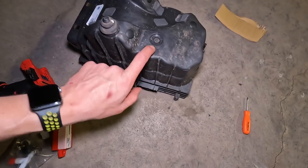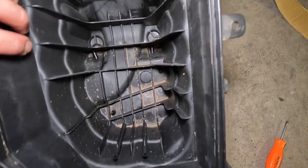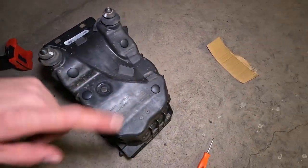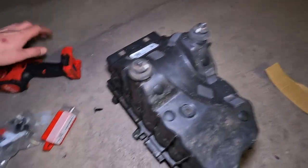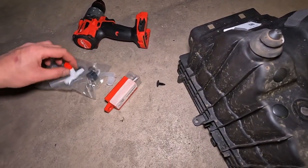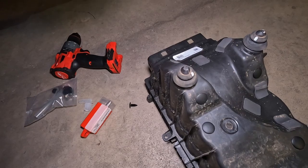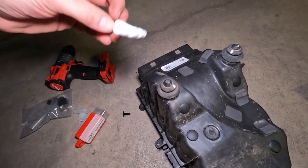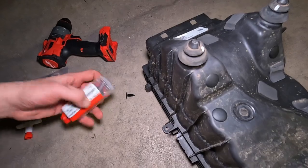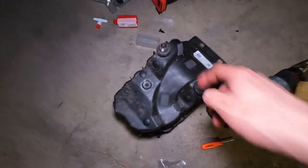They include a bunch of push pins to cover up the inside of your air box — those are to seal off the factory drain holes at the bottom. I will use silicone around those as well. But first I have to drill a hole for the new drain. The new drain has an actual valve, so when you're doing water crossings you can close it off for a full seal. If you're daily driving, you can leave it open so any water that gets in will still drain out. We're going to drill that hole at the lowest point of the box to fit that fitting.